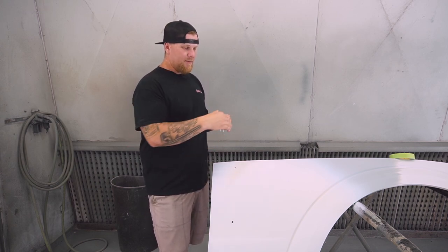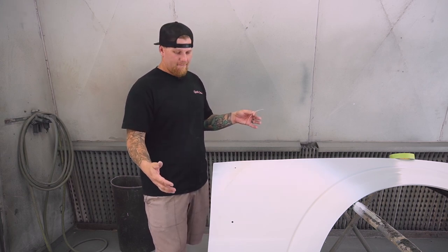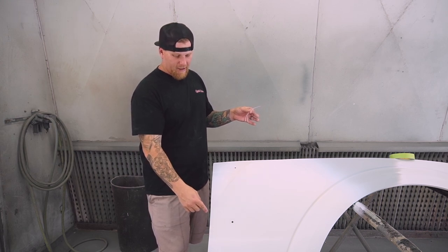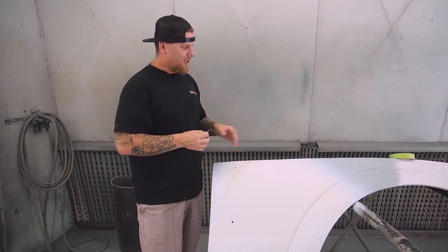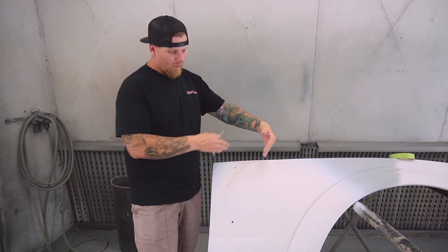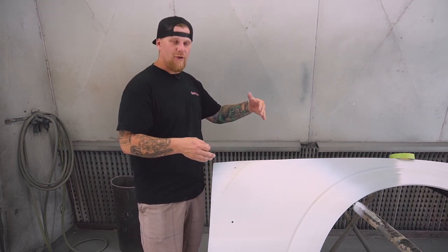When it comes to the bus bar, you need to have a third of the surface area that you're going to be lighting, and you need to make sure that you have coverage around the perimeter as best as possible. Yes, you can do a bus bar in one direction feeding over this area that's going to light, but maybe at the bottom area it might be too dark.